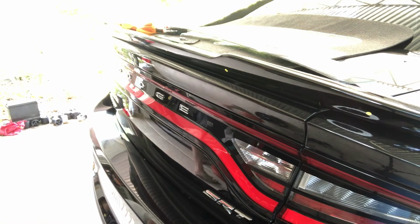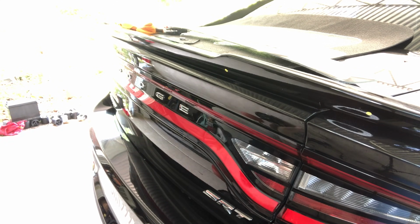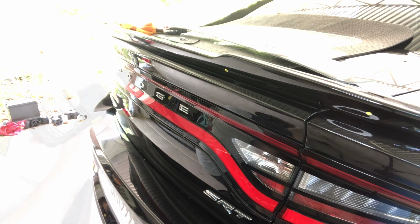Start with the smaller one, and I don't think I want to go with a 3/8 this time. I think I'm going to go with the step down, which is the 5/16, because that hole did seem fairly large. I'd rather it be too small and have to make it bigger than too big, because once you make it too big, you're screwed. So we're going to forget the 3/8 for right now. We're going to go down one size.